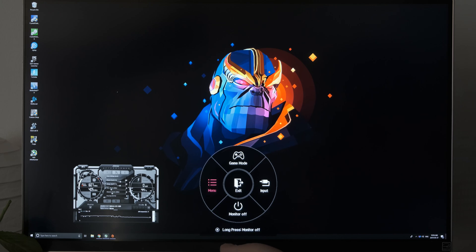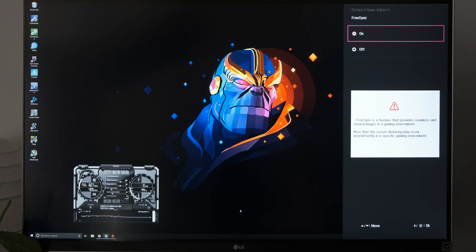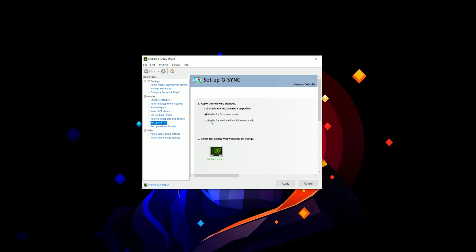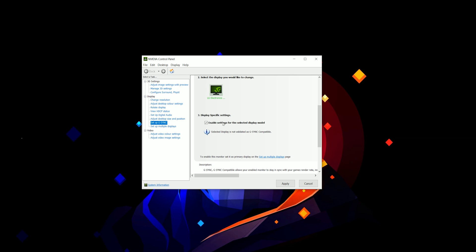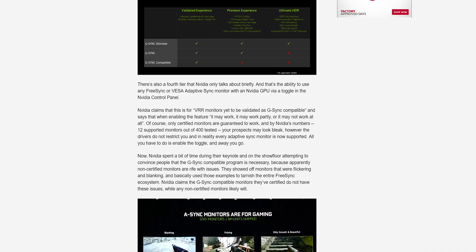First things first, you need to actually enable the FreeSync settings. I go into the menu in my monitor, then into the picture menu, then there's a game adjust modes menu, and in there you can switch FreeSync on or off. After that, I went into the Nvidia control panel, which has a submenu for G-Sync settings. You go in there and have the option to switch G-Sync on, then choose either full screen only or windowed and full screen mode — it doesn't really matter which one you use. Then scrolling down further, you get the option to switch on the Adaptive Sync settings for that specific display. Nvidia does say here that my screen, the LG 27UD88, isn't a verified panel, but there is information on the internet that says some unverified panels are actually capable of doing this, so you can switch this on.